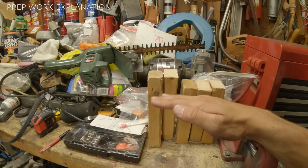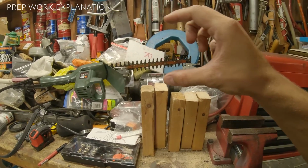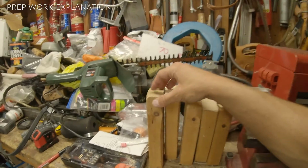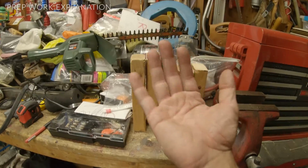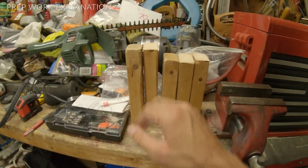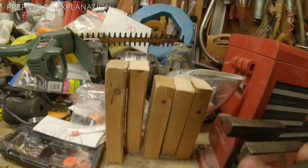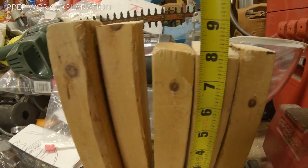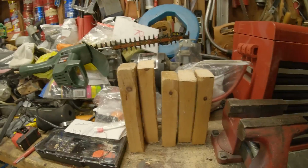And then once I have the engine lifted up, there's going to be space under it between, I believe it's the subframe and the engine, where I'm going to also sit some wooden blocks in case there ever was a jack failure. I won't lose my fingers or my hand. So always be safe rather than sorry. And the short ones measure 8 inches. Got about 3 of those and 2 9-inch pieces. I figure I'd give myself a little variety.